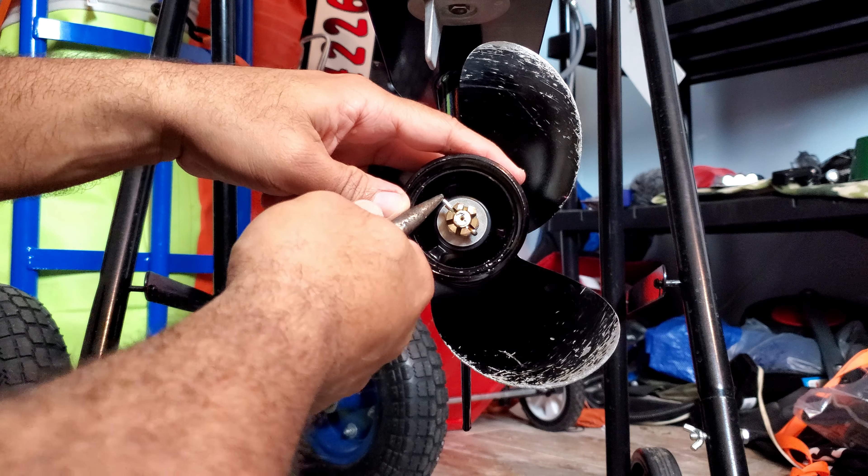Here is the new propeller. You want to keep it hand-tight because it has a little rubber bushing that cannot handle a lot of pressure — just enough to seat it. Slide it on like so — looking beautiful. Then put the washer in place, then the nut. At this point you don't need the towel since it's only being hand-tightened. The key is to get the alignment right so you can get the new cotter pin in place.